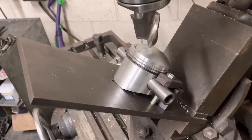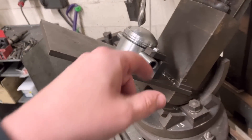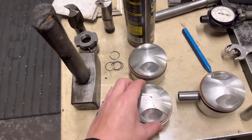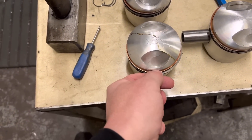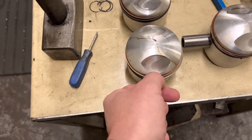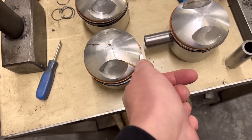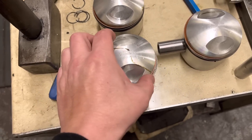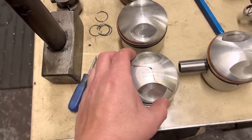Right guys, so as you can see, first thing this morning we're just opening up a set of valve pockets on these Alpha Pistons. These are for Bob Dove and we're doing exactly what we did for his son Paul. So what we're doing is we're opening up the pockets on both sides, inlet and exhaust, about one millimeter. And then what we're going to do, we're going to put the pistons in the lathe and turn the outside out about a millimeter in and about a millimeter down, just so it clears the gasket or any potential failure of touching the gasket. And that's what he wants, so that's what we're doing.